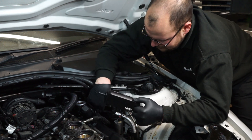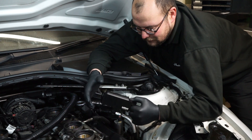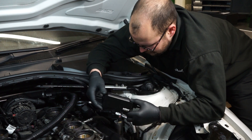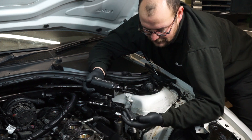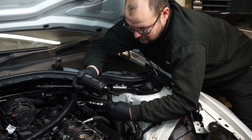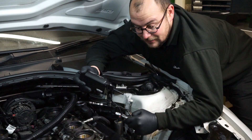Moving on to the NRW fuel filter kit — the fuel rail is already disconnected from doing the injectors. Going through the kit fresh with the car in front of me, it's mostly made of three components: the fuel filter assembly itself, which bolts onto an existing bolt using an extended bolt included in the kit; a blank for the fuel rail pressure sensor on the rail; and you move the sensor to the new filter housing, connect up the fuel lines, and the job is done. Really easy.